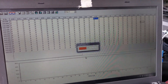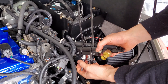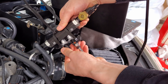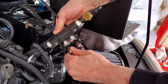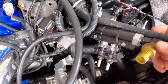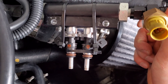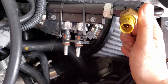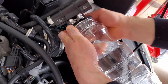I've changed the map to two milliseconds now to see if the injectors fire. I'm pretty sure they will, but we'll see how low we can go. After flashing the two millisecond map, we had a bit of a scare — the injectors almost completely popped out because of fuel pressure, so I had to redo the zip ties. With the ignition on and fuel primed, they seem more stable. Let's give it a shot at two milliseconds — looks good on both.